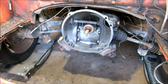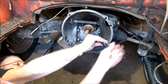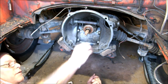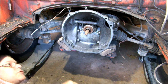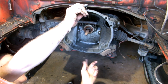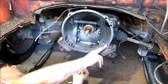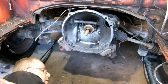Take a 13mm socket and take these mounts off — no big deal. They're just regular little flat washers but they do have a little bit of curve on them, a little tension, although they're probably worn out. There you are: four nuts, four washers, and this will lift off. The front mount is still bolted up, so we've disconnected the clutch cable and the four nuts for the mounts. Now we're going to move on to the CV joints.